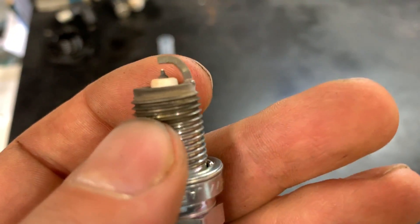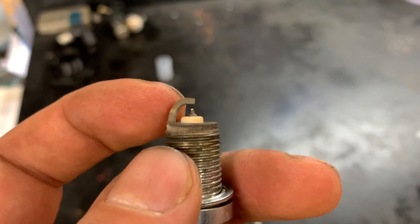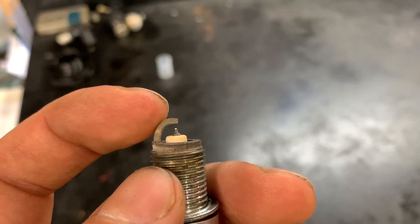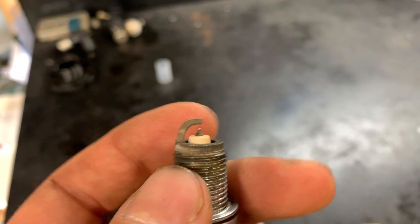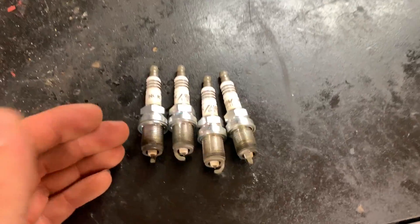The tip has a two-piece design — that very tiny top part is actually supposed to be laser-welded on. So if it just looks like one piece of metal, it's probably not real. Also look at the ground electrode prong — it's supposed to make a smooth arch across to the top, not a 90-degree bend. If you see something like that, keep an eye out. I'm not too sure on these plugs — an expert could probably chime in on whether they look fraudulent.